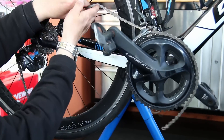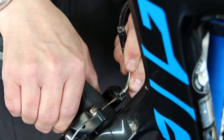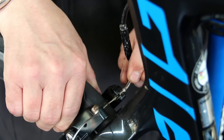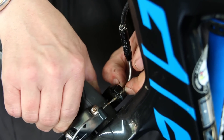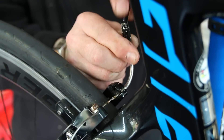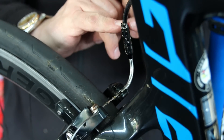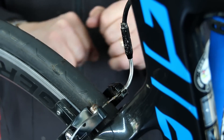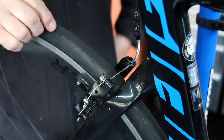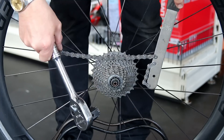The first problem is the brake caliper is not releasing from the cable guide — the cable guide has actually come into two parts when it should be one. The thumb adjuster is completely corroded up, so we need to get all this off and address these issues, replace the cable, and sort this rear brake out. This is the primary importance of this service, so we'll get the bike apart as we do with any other service.